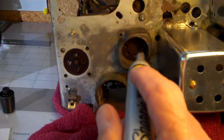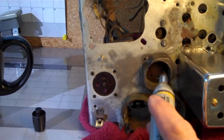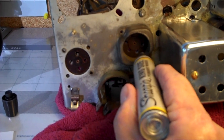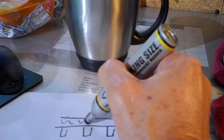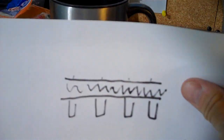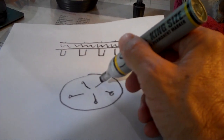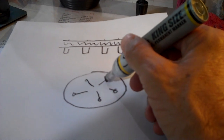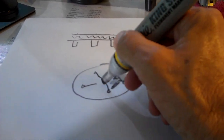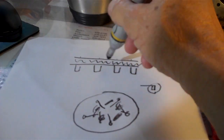So here you come with your cleaner — your spray cleaner, your naval jelly, your soap powder, your whatever you're going to clean your chassis with — and you get it down in those holes right there, and it runs between the two layers. That is something you do not want. You do not want any crud and crap between those two layers. It dries, or it stays damp or gooey, and you turn on your radio — it could be days later — and all of a sudden you've got sparking going on, sparking between these metal pieces sandwiched between the two levels.